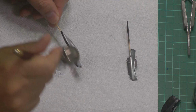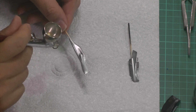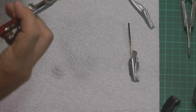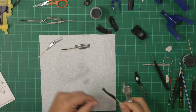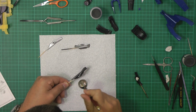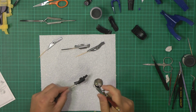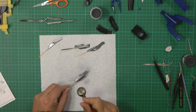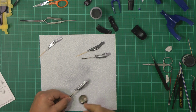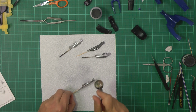To be honest, we've got to do the inside of these, but like there, that was a little bit too heavy, just about caught it in time. But if you go in too heavy, it tends to pucker up. And when I say pucker up, it tends to tear, it dries and pulls itself apart and everything else like that. Also, this is onto neat plastic, which is a real naughty. You shouldn't do this. This is why we're doing a very light pass first, then come in. Everything that I've done primed, we haven't had a problem with. But if you do come in and you use this stuff when it's not totally ready, you can end up with real problems, okay? Once you've got a coat down, it's not so bad, okay?